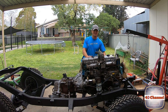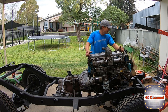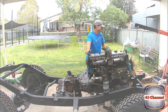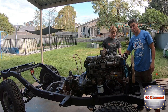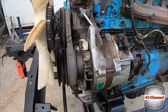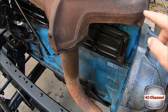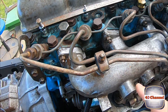I can give Duncan back his engine mount which he kindly lent to me — thanks Duncan, you're a legend. Duncan's more of a Nissan man so I won't hold that against him. Our next plan is to do a very basic strip down of the motor, give it a really good clean, then give it a nice paint to make it look pretty. We'll strip off the exhaust manifold, the intake manifold, take off the alternator and any other bits in the way. The exhaust manifold has two broken bolts — they're missing. The intake manifold just down here has a blowing gasket which probably was never put in right in the first place, so it's worth taking these off and replacing them.